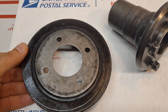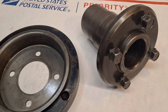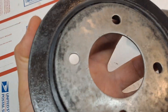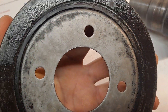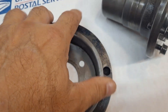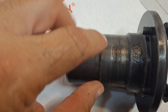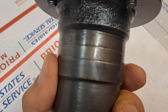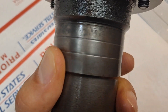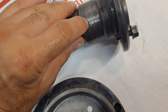The most important thing about the balancer is that the rubber seal is entirely intact. It's been dynamically balanced, and the primary seal diameter of the hub has perfect surface integrity, meaning there's no scars or pits on this particular diameter right here, which is where the seal occurs.